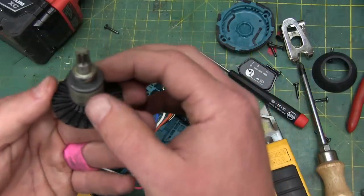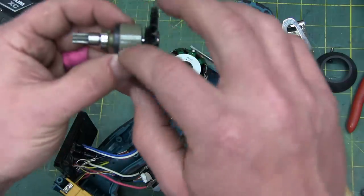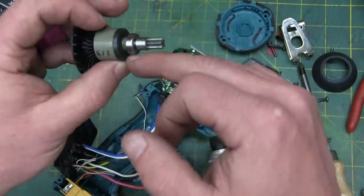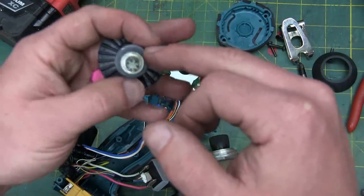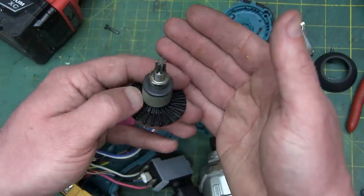Tiny, you could say. So I don't see any laminations. It looks like a solid core. Of course, there would be magnets in here, but there's also a ferrite along here. Now, is that ferrite for sensing the position of the rotor, or is it for something else entirely?